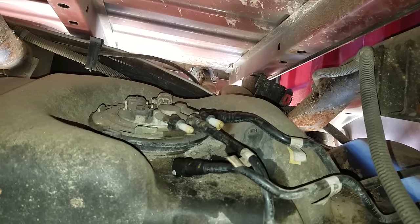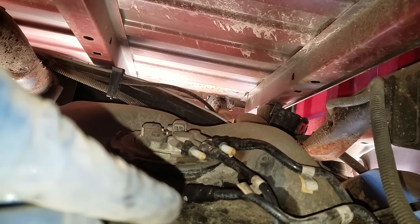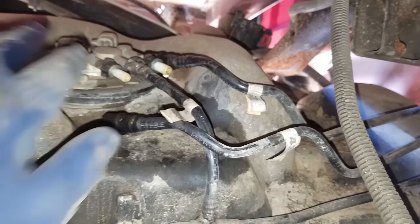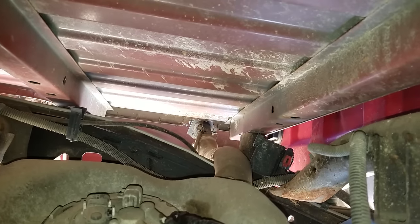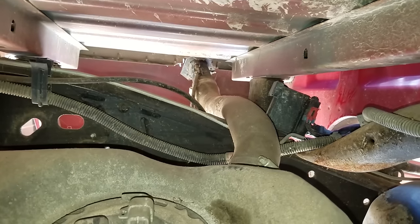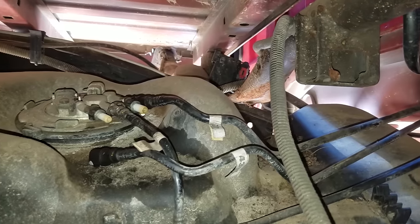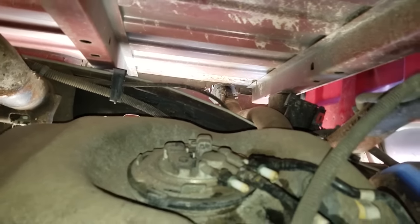Now you can see where the lines go into the fuel pump. This is the top shot of the gas tank. We disconnected that one and that one — you just squeeze the little thing right there on both sides of it and pull it off. The lines are clipped to the tank so disconnect them. We left this long one on right here but disconnected it from the evap canister. You're going to have to snake the filler neck back or disconnect that hose clamp right there. Also make sure you disconnect those two electrical connectors and lay them off to the side.